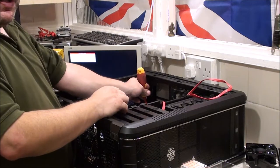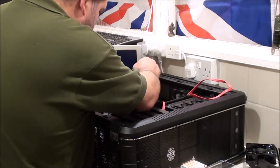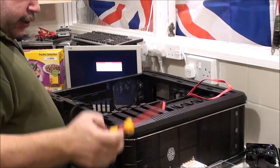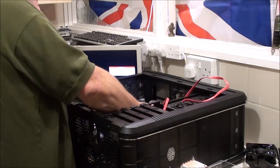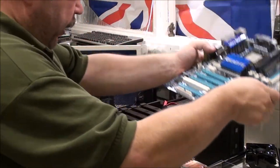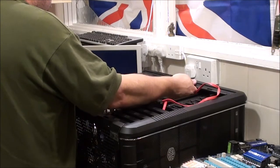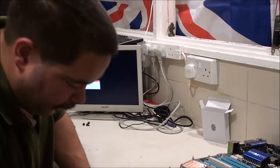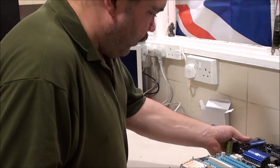Wondering why I actually put the motherboard in here, it was just to keep it safe anyway, because it was just laying around here in the kitchen. And after my other i7 board failing, due to me being a complete idiot with it, should not have brought it back from Mum's in a backpack without any anti-static bag or anything on it. That's probably what killed it. So, yeah, don't do that.